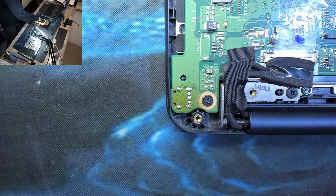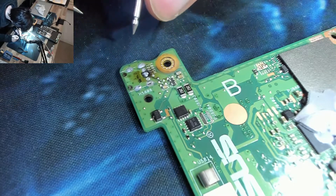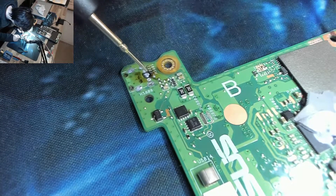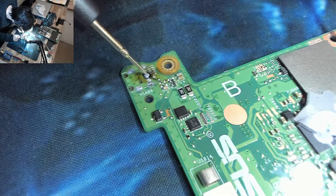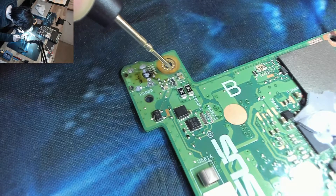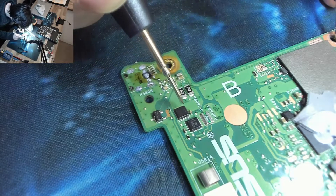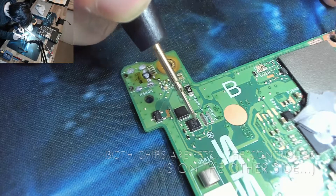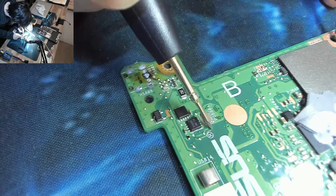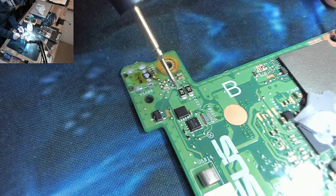So that connector has got to come back off. We're obviously working with no schematics here — this is a poxy little netbook. So here is our problem: if I put one probe on ground, there's our beep. Those points are all ground. Now here's our main VCC pin — our positive power pin — and that is shorted to ground as well. Following this along, it comes up to this section where we've got a capacitor crossing to ground, and then MOSFETs controlled by this chip that switch the power supply into the main circuit board. Then there's a bridge point going off to the rest of the board, and those two little traces will be current sensing, which goes back to this chip so it can see what's happening.